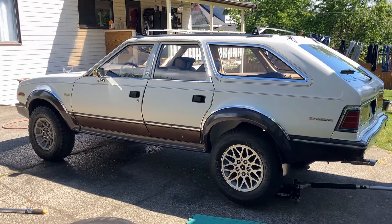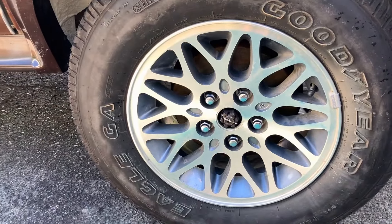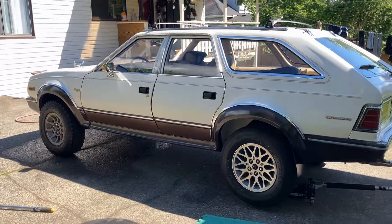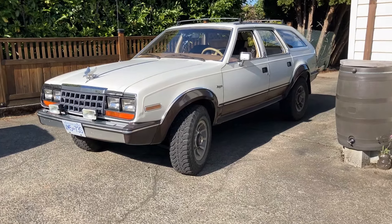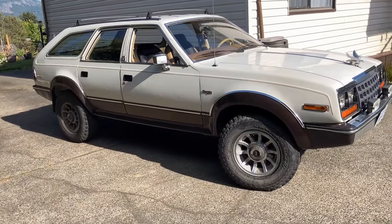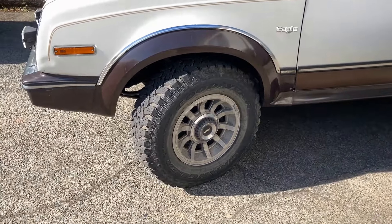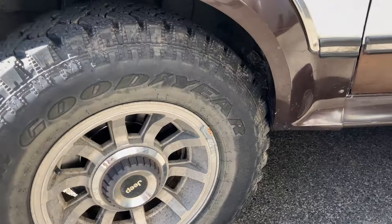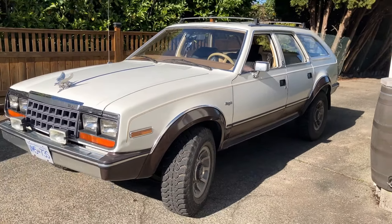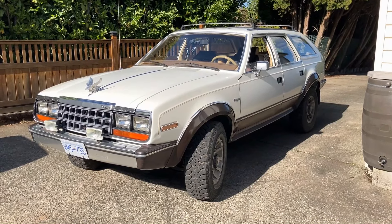We'll give these turbines a try, but the newer ones — you wouldn't be able to get the center cap on the mag. The 15 by 7 inch turbine wheels fit on the Eagle; the hubs clear and everything. The 235s rub on the fender flare, so I'm hoping to get some all-terrain 215s in the future. But even with these different wheels, there's still a vibration coming from the back when braking.